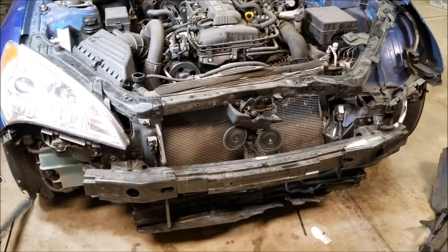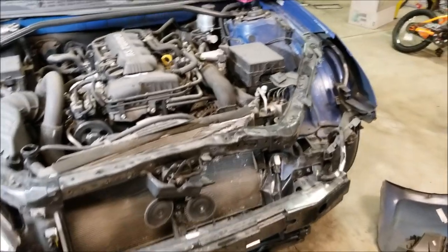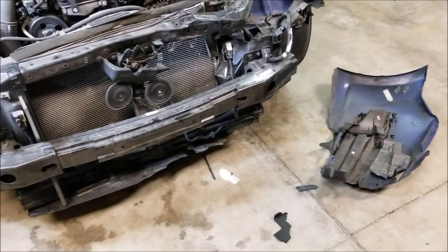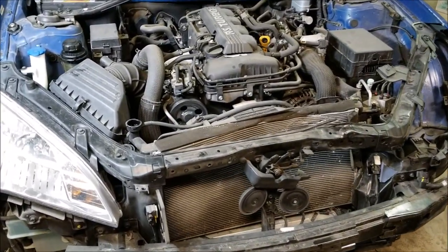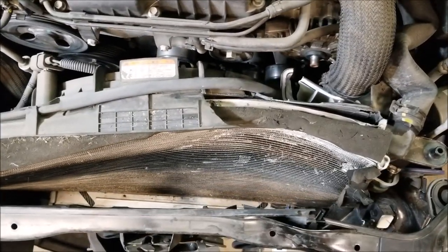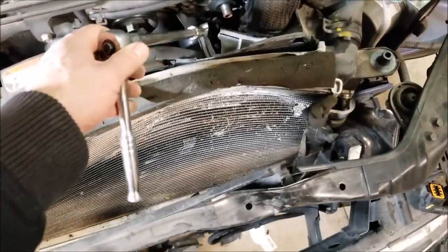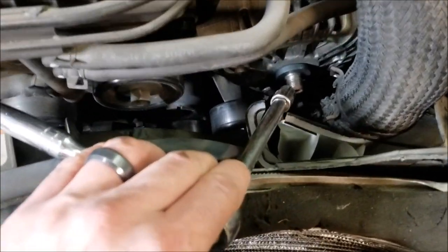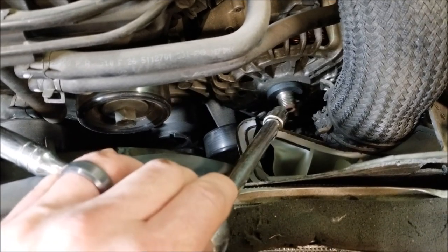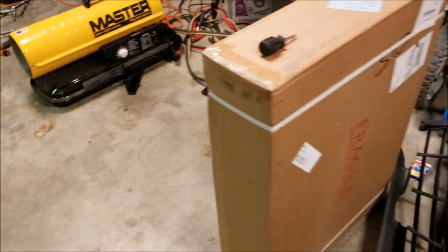It had low miles on it, and the wreck looked to be pretty cosmetic from what I could tell from pictures without seeing it in person. I've already removed the shattered front bumper. Looking over the car before driving it to my house, I noticed I needed some things to order. I ordered a radiator — as you can see, this one is slightly moved in. I ordered a cooling fan and a coolant reservoir. Also, the alternator pulley was broken and shredded the belt, so I ordered a pulley and the serpentine belt. Some of the things have shown up: this is the belt and the coolant reservoir, and this is the cooling fan.